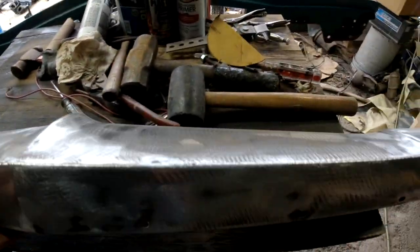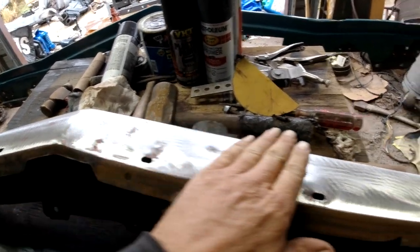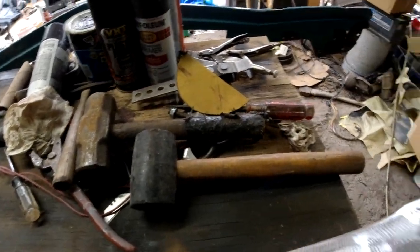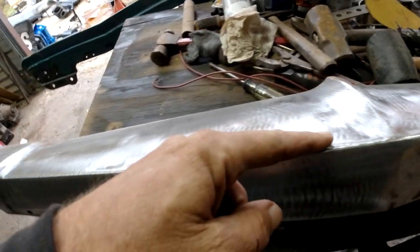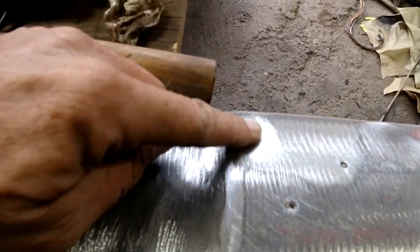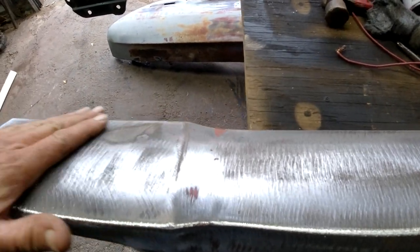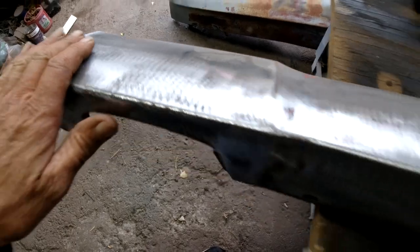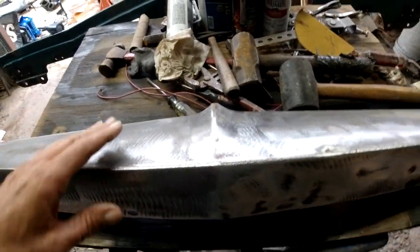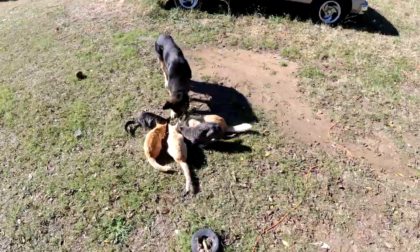I got this header panel stripped down. This was the main dent right in here - I banged it out a little bit and had to put a little body filler in. There was also a dent right here and a crease along here so I got to skim that. The only old bondo was right there, a little dent. I'm going to put a little body filler on that and then strip this filler panel.